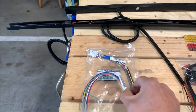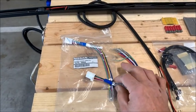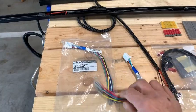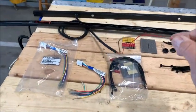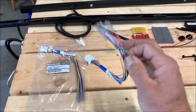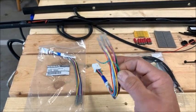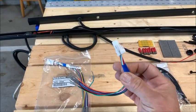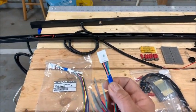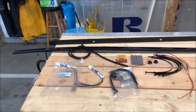This is the accessory connector. I showed you where the accessory connector was in the vehicle, and I'm telling you that this is the best way to go. I'm going to wire this end of the LEDs when they come in, when I run them through the hole I drilled. I will tie them into here, and I don't have to tie them directly into the truck's wiring. Then when I'm done, I will simply take the service connector, plug it in underneath, and hopefully everything will work the first time. But I just wanted to show you how the kit comes.